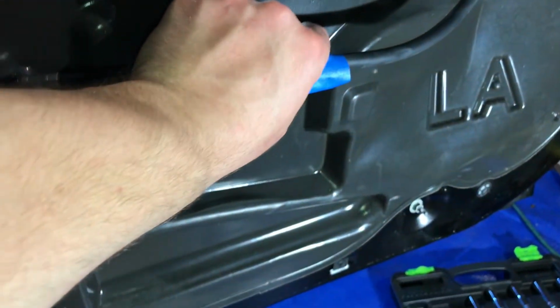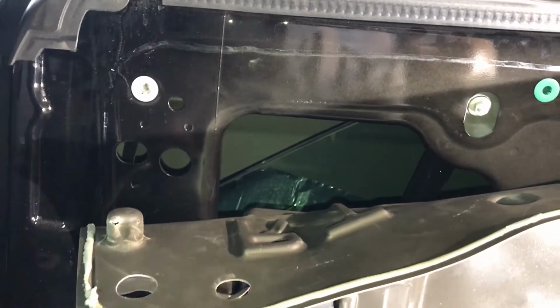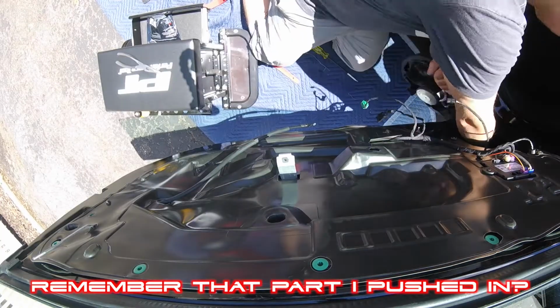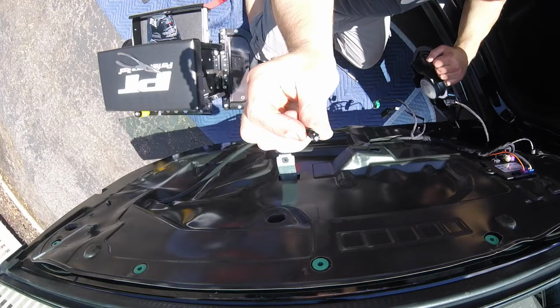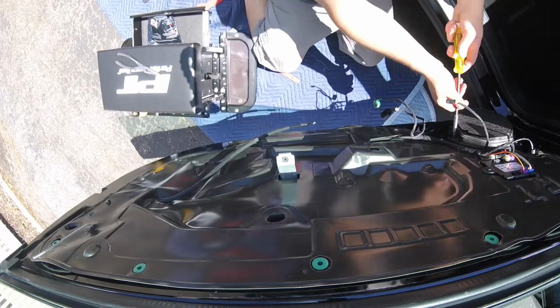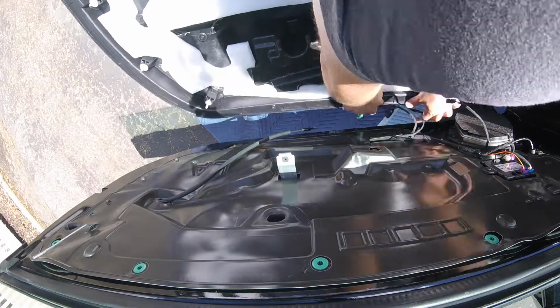you secure them. Okay, we're back, and now everything is nice and secure, and nothing is down below the door line. So when we open and close the door to work on the car, we will no longer need to worry about stuff getting jammed and scratching our door sills. If you wind up dropping anything into the door, you'll want to go through the speaker hole by removing the 4 Phillips head screws and holding the speaker in place while you root around inside the door to find what you lost. Reassembly is basically the reverse process, putting all the plugs and all the screws back into place, again making sure you have something to prop the door panel on before you get started.